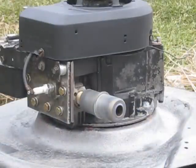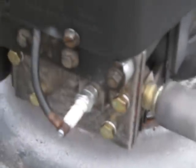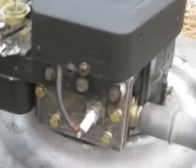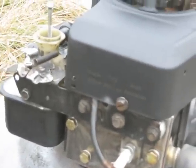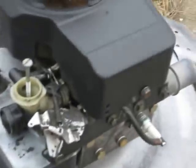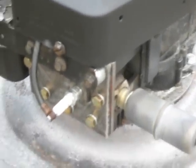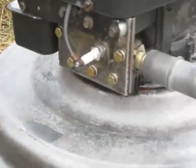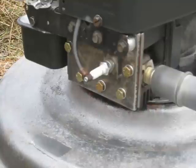It must have burned through the piston crown — it was a quarter-inch thick oak. She sure came to a standstill. I guess I've got some zoom issues here, a little close up. So as you can see I've made a steel cylinder head for it — it's just a three and a half horse Briggs lawn mower engine. The piston crown is a quarter-inch thick oak screwed in place. It ran quite some time before it burned its way through. I'll show the damage here in a second.